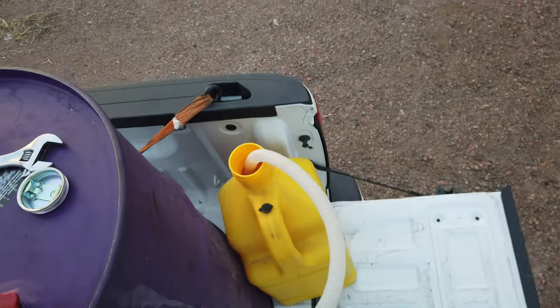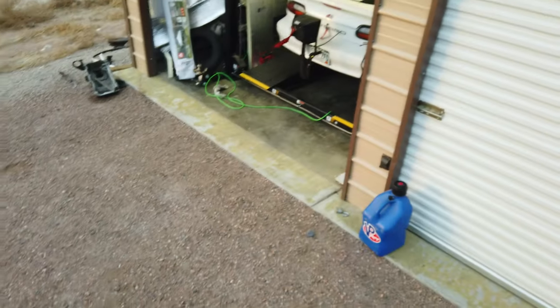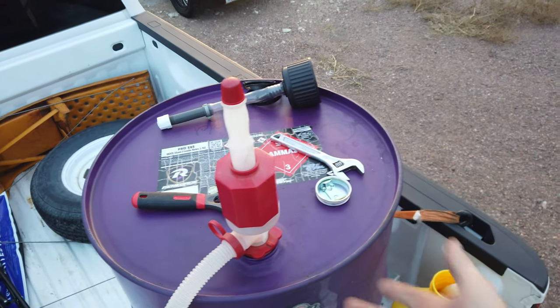So, yep, that's kind of how I get my fuel from a place to here, because ever since I've been running E, I recommend anybody that runs E to buy it by the barrel. As you guys can see the other night, it's starting to get a little cold out here, but the injectors are actually pretty clean. They weren't too bad, and that's not treating it very well, letting the car sit a lot and all that stuff. So the better fuel you get, plus I run some DP, like Ethanol Shield. It's like a little green bottle you can buy. That seems to have helped too over time as well.